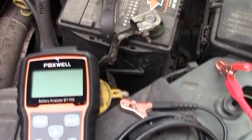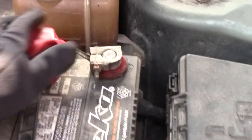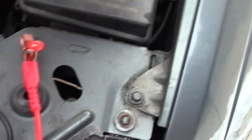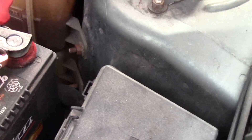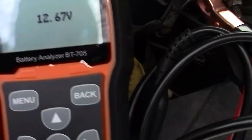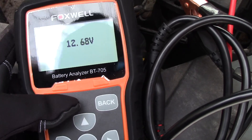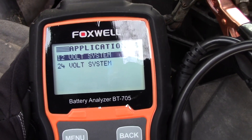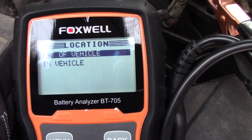So here we are outside at the car. We open up the hood — here's my battery. To be safe, I generally connect the negative first since the negative has no power. Let's plug in the negative first, then go with the positive, and the unit should turn on right away. And there it is — it already gave me a reading of 12.9 volts. Going into the menu, we do a battery test to see how this battery is performing. Press enter — this is a 12 volt system, so we pick 12. If you have a truck it would probably be 24.